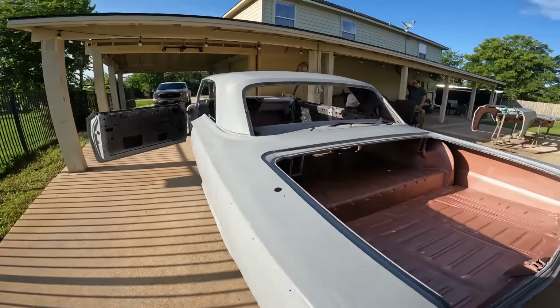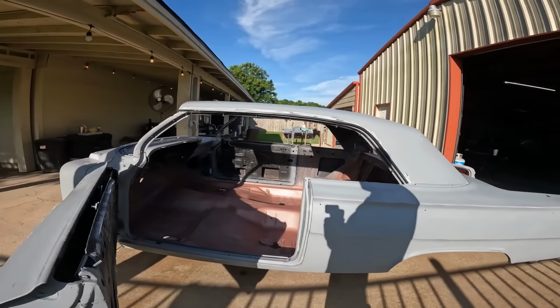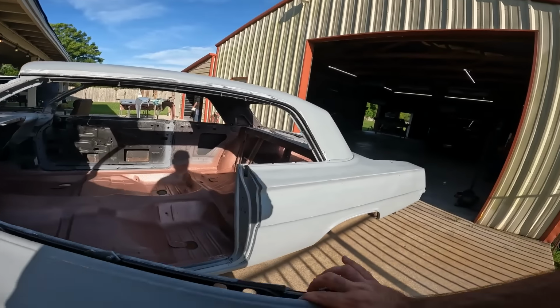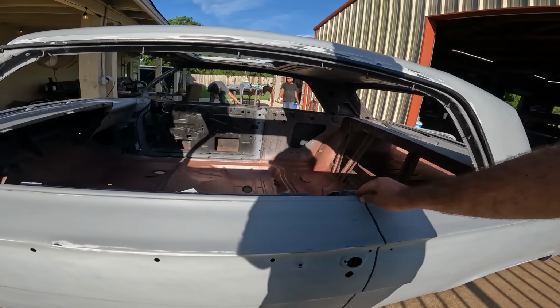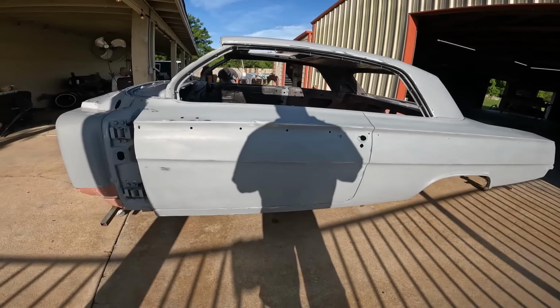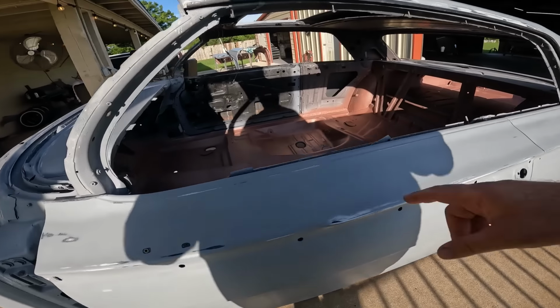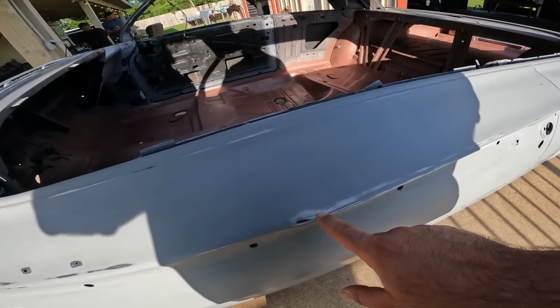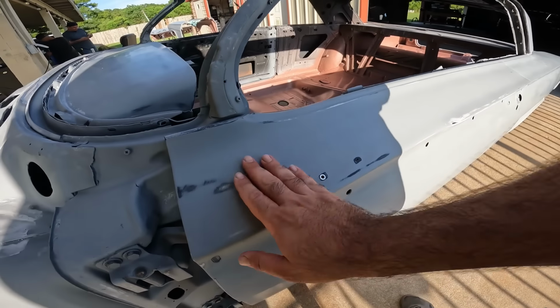It's pretty dry. So we did everything we were supposed to do. We wet sand the whole entire car, 400, 600. Washed it. That needs a little bit of oil. But washed it. Dried it. No big breakthrough. So what we're seeing is 2K urethane, G2 epoxy. No bare metal anywhere really.